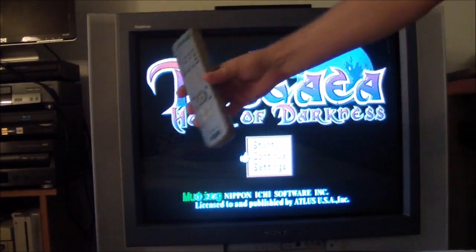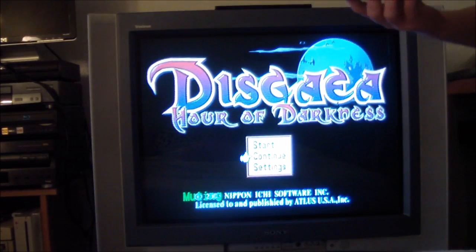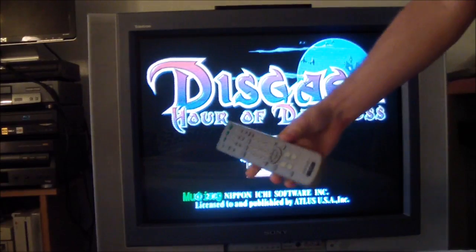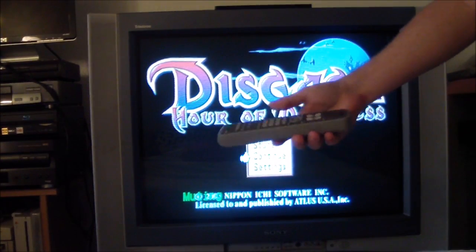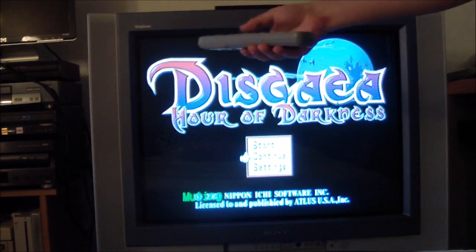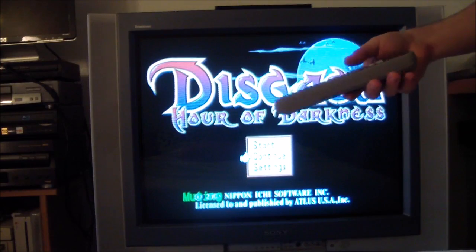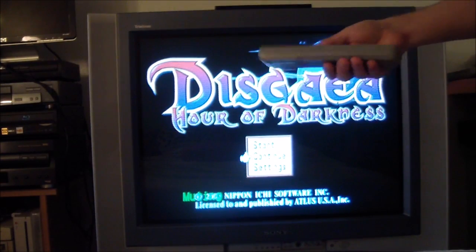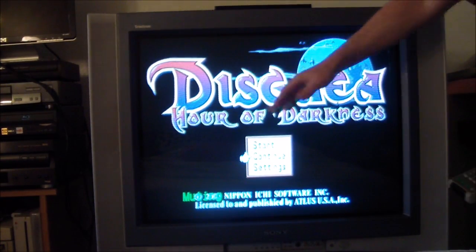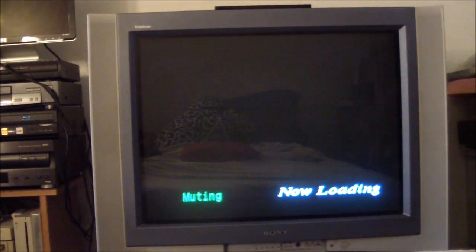Get the remote. If it doesn't come with a remote, you can find them online. This is the RMY180 remote, and you can look it up. I don't remember the code off the top of my head, but you have the TV off and you put in this code and hit power and you'll get a service menu. And you can do adjustments to vertical and horizontal geometry and stuff like that. And then you could play around with colors too to fine tune it, and that should fix a lot of problems.